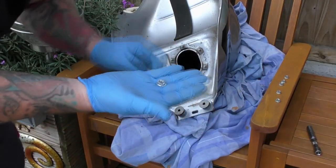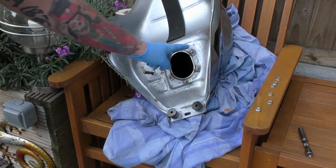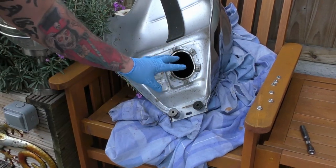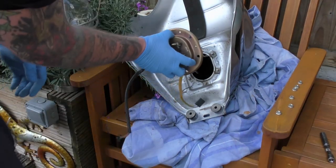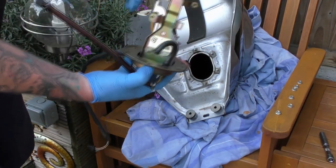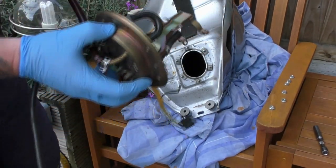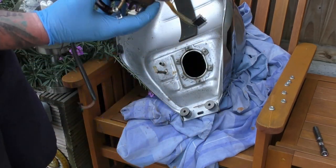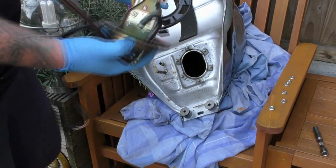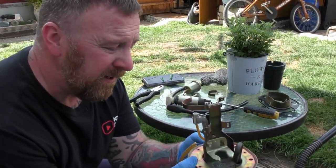Just six ordinary 10mm bolts. Turn the tank upside down — it's got a bit of fuel in there — undo the bolts and they'll come off nicely. This unit just sits in like that and then comes out. It's not too much wiggling. The filter is still very good and it pushes back in with little clip bits.